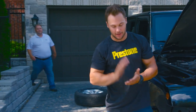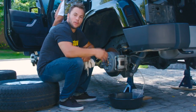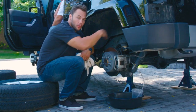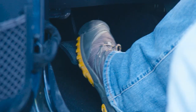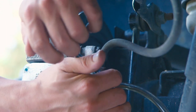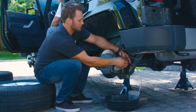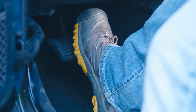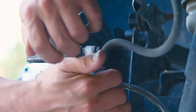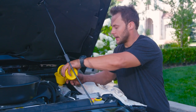For this next step, I called my buddy Tom to come and give me a hand just to make my life a little easier. With one person in the driver's seat and one at the wheel, when you're ready with your hose and wrench in place, you say to the person in the driver's seat: brake. You then open the valve and you'll see dirty brake fluid come out. Care must be taken not to let air into the system, so before he releases his foot off the brake, you have to shut the valve. Release. Repeat this process until all the dirty fluid has been drained out and you can only see clean fluid. But make sure that you don't run the reservoir dry and suck in air that way.